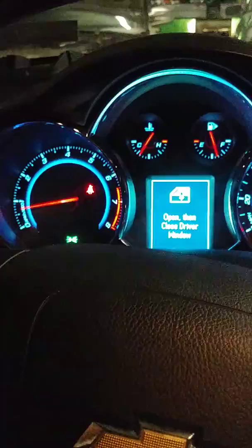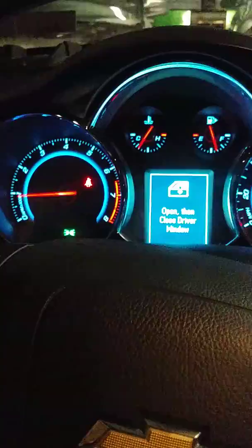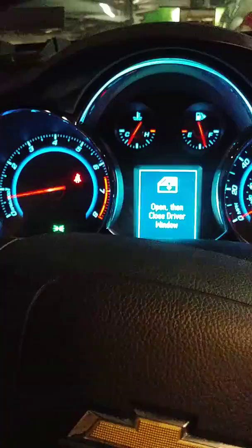And in this case, what I did was I pulled up the diagram for the turbo system, so that once I look at the schematics for the turbo and how it works, it allows you to take away looking at the engine and just look at what the problem could be, which is your boost sensor, your intake, and your MAP sensor. So if you notice, I said those three things. There's four, which is your intercooler. There's five, which is your turbo.